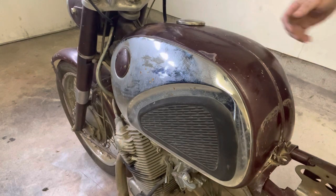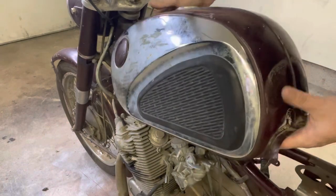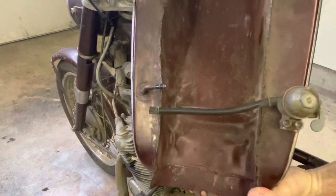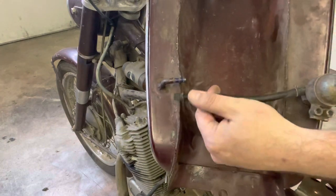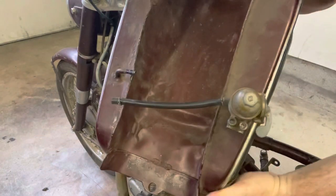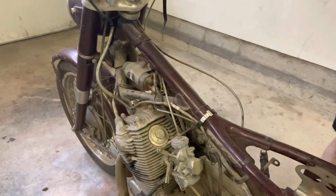Just like so many Hondas, these gas tanks are going to get hung up if you don't go underneath and get rid of the crossover tube. There's a crossover tube that balances your tank — it plugs into one side. Make sure you pull one of those off. We've covered that extensively in other videos. Here's our tank — we're going to pull that off and set it aside.